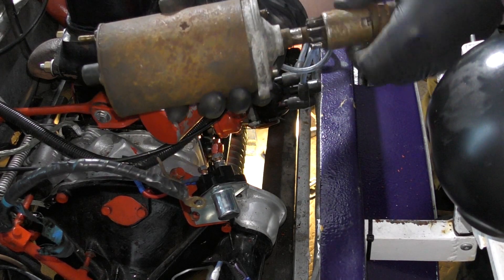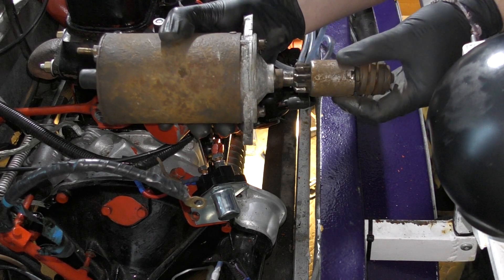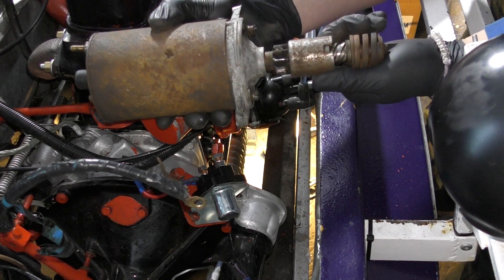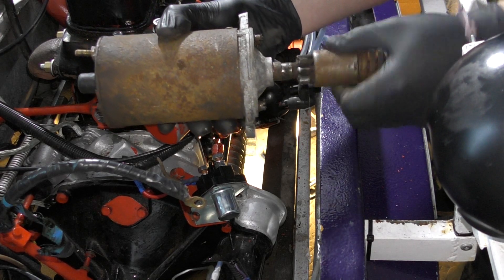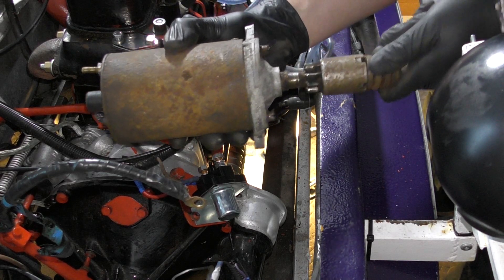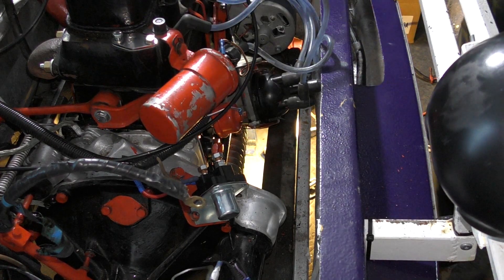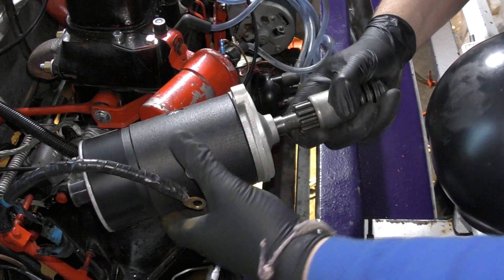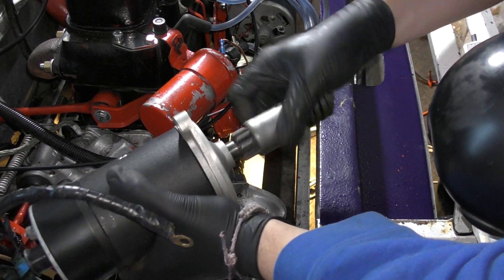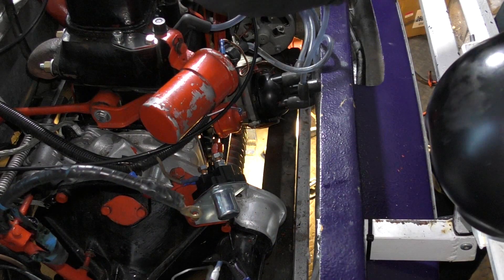There it is. It's all free turning, so when you turn the key this gear here returns back and as it spins it turns the flywheel. What is happening is it's turning the flywheel and then it's getting fed up and just turning back and then rotating. There's also quite a bit of play in that shaft there. So out the old, in with the new. Here is the new unit — there's no play in that shaft at all, and as you crank it that is working absolutely lovely.